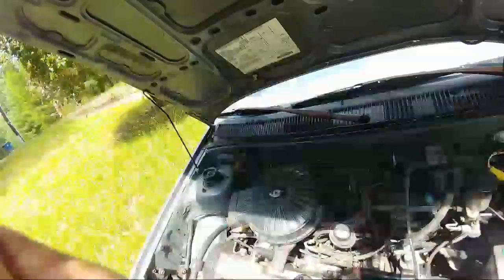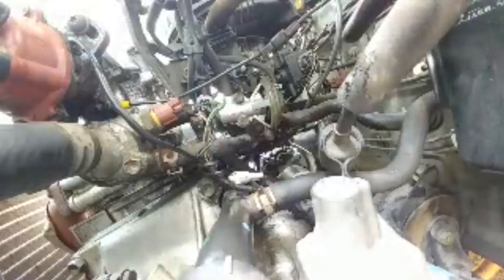Although, 20 minutes ago. Come on. Yes. And it opens and closes. I got that simply because every time you have to loosen the damn wire, you end up wearing it out prematurely. So I installed a knife switch. I've got one on this car, Chevy. Because it's a pretty common thing for me to be disconnecting batteries. And I have had to replace batteries because the damn terminals were wore out.